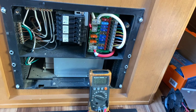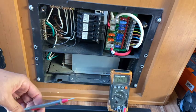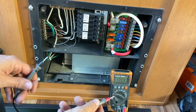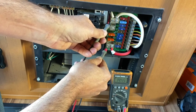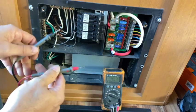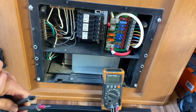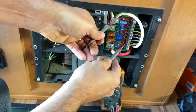The next step is I've got to disconnect the battery and disconnect the power from the house, so that's what I'm going to do next. At this point I've unplugged the camper, I've disconnected the battery, and I have the power disconnect in the off position. So now DC volts over here — let's check them and see what we got. One thing I wanted to make sure was that there was no power feeding from the battery on the coach.